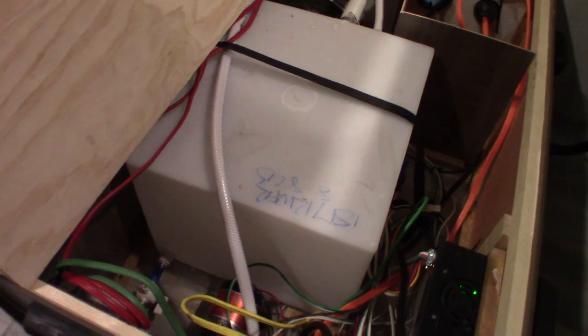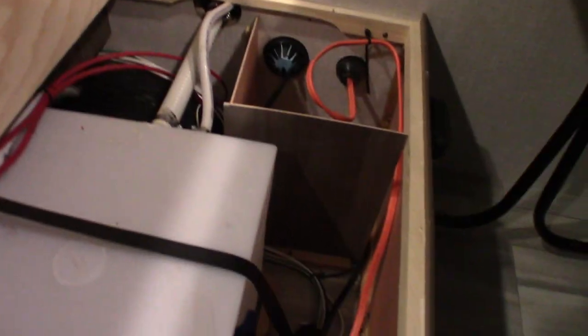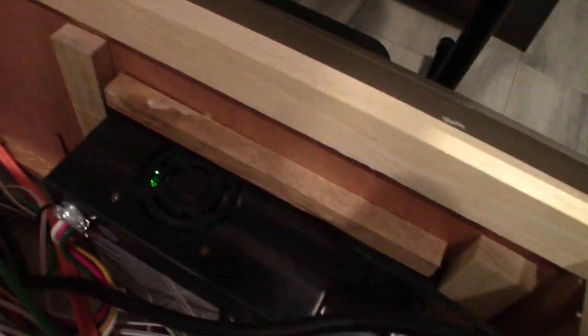Right now it's set up so that when you run the water pump, it'll draw right from your fresh water tank, right? You can see how the valve here is parallel with that line. So right now, if you had water in the tank and you turn on the pump, it'll pump water from the tank. Like I was saying before, if you have city water, you don't have to worry about this. This is only if you don't have city water and you're boondocking or whatever, okay? So that's your water tank, and this is your water pump right here. This thing here is the back of your power converter. I'll show you that in a second.